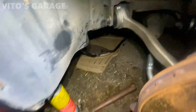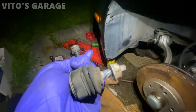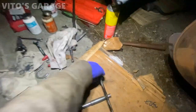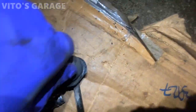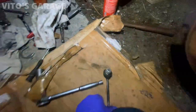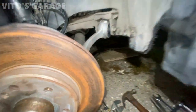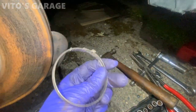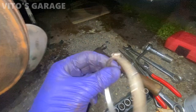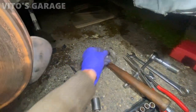Last thing I'm going to have to deal with is the sway bar. These sway bar links are actually super bad - I didn't notice at first, but this one is actually bad and has play. So I'm going to order new ones. Basically the entire front suspension is going to be brand new, except the struts - struts are okay. I got this side almost out. I'm going to be reusing these clamps like I did on the other side. If you carefully take it off, you can reuse it.